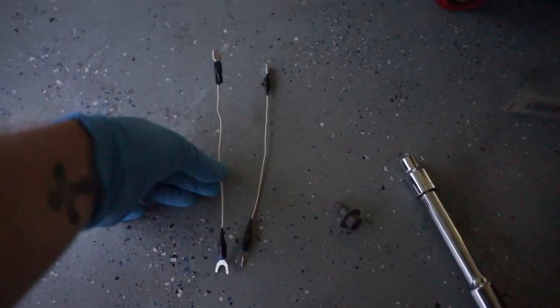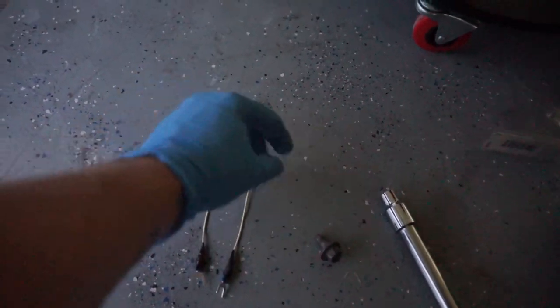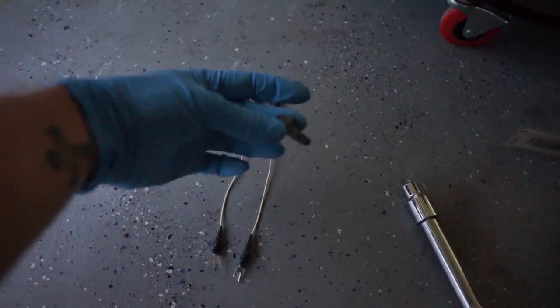So here's what I did: I've made two grounding wires with a little C-connector on one end and then the terminal connection on the other. I'm going to use the big bolts that hold the crash bar on to ground to the body. On the car — it's a little hard to see since it's dark — I ran two wires to the power cable that goes to the stock horn. These also have little terminal connectors on them. I used my soldering iron to get those in so they're nice and connected. Now I'm going to hook the horns up and just make sure that it works.